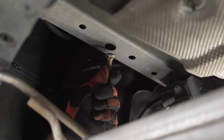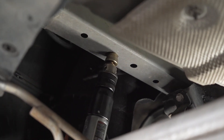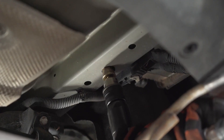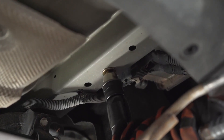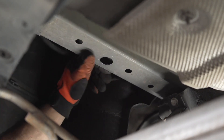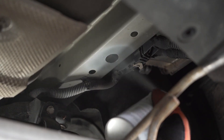In order to fish wire our hardware into the frame, we need to enlarge our access hole. We're going to do this using a one inch step drill bit. Repeat for the other side. After drilling your hole, spray something on the raw steel to prevent rust like a galvanizing compound. Allow to dry before fishing your hardware.